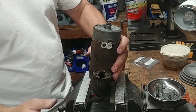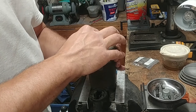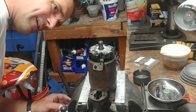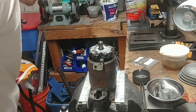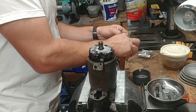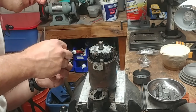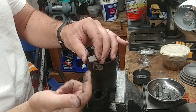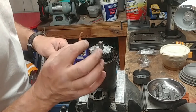We can do two things: we can take the cover off the end where the brushes are. It's actually relatively clean. Looking at those brushes, it's almost a shame if I replace them because they are not much shorter than the new ones that are here in my little baggy. Let's compare - I don't have a donkey in the corner that poops dollar bills or a chicken that lays golden eggs. The brushes are only about a sixteenth of an inch shorter than the new ones. The ones in here are just worn in a little more, so I don't think we're going to replace the brushes.